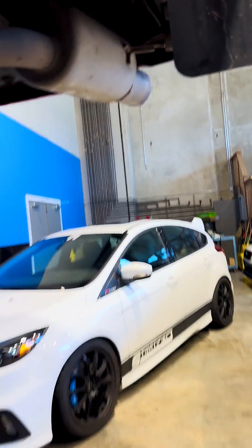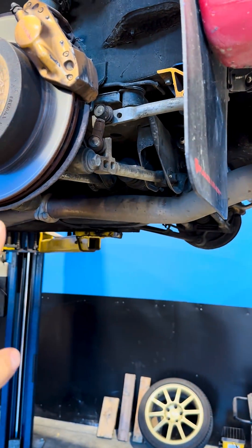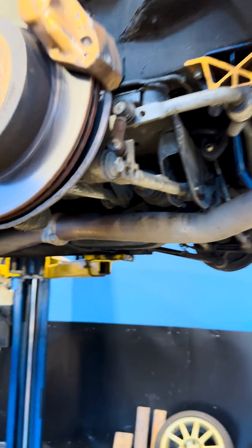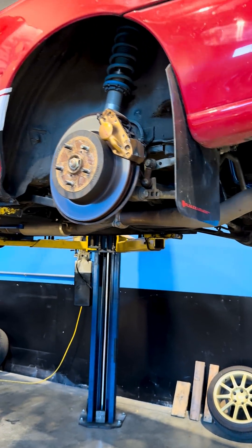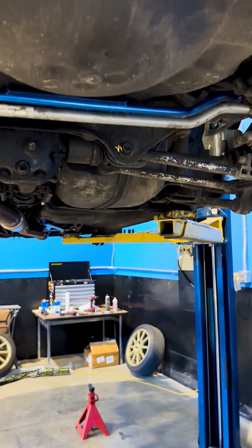The difference between the back and the front — the balance between the back and the front — is that the stiffer the bar on a particular axle that you have, the more cornering load you transfer to that particular axle, and it will slip first.